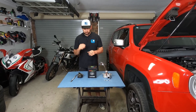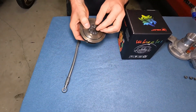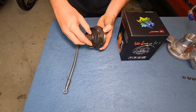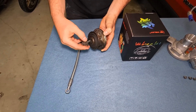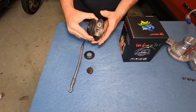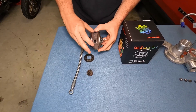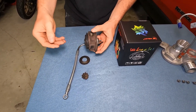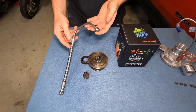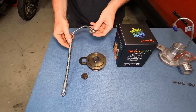As you could hear, that was not a healthy engine, and I'll show you exactly what went wrong. This is the old rotating assembly off the car. When I removed it, the main thing I found was this nut was actually loose on the cold side, which led to a lot of shaft play. But when I pulled off the hot side of the turbo, the turbine and this washer just fell straight onto the floor. The oil is completely congealed inside the unit — whether it congealed first and stopped lubricating, or the turbine broke and generated heat that congealed the oil, either way it's completely shot. The oil feed pipe was also congealed all the way from the end down, and it's taken me a long time to clear that pipe out.